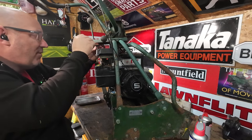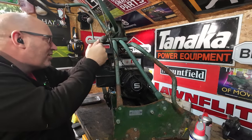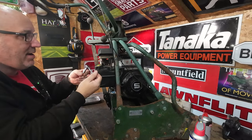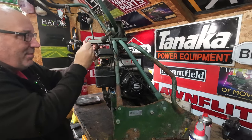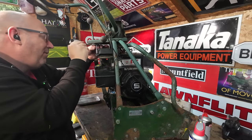We want to try and remove the air filter box next. Now there's all this metal work up on top, so I don't want to remove this unless I really, really have to. So a little tiny, what's that, 8mm on there? It's about an 8mm, is it? Let's have a look here. Yeah, 8mm. 8mm nut here to do. And maybe an 8mm nut on the other side, and that will take the black plastic air box off